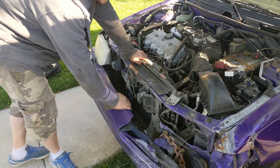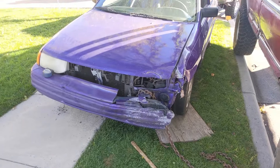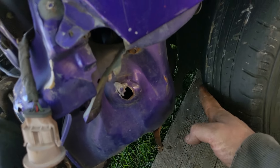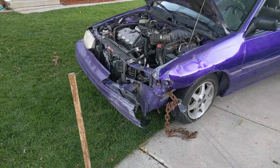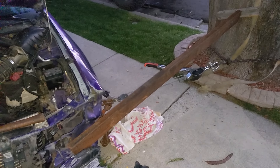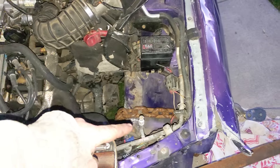The front of cars made in the last 20 to 30 years - all this stuff is paper thin. Everything on the whole front end of a front-wheel-drive car is just the thinnest sheet metal ever. But looking at it now, everything is 90% there, very straight. Before, I could barely fit a finger in there. Now I can fit a fist - we've moved that out two and a half inches. I put a C-channel - a two-by-four would work too - pushing on the outside of the frame while the chain pulls on the inside. You can see we are pretty much dead straight. It'll bounce back a little, so while it's in this position I'm hammering on the seams.